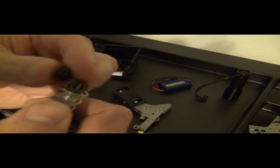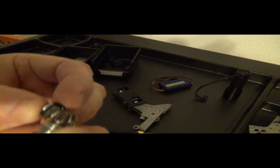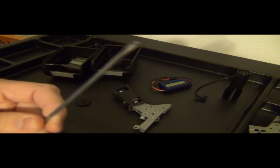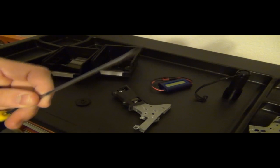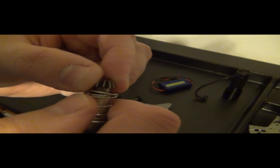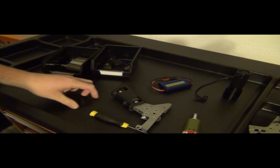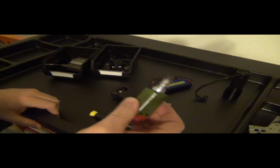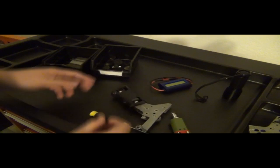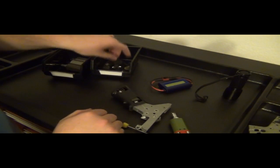Here's a Siege Tech pinion gear. And you can see it's a tiny bit smaller than the Ame Top. And it is actually more of a 45-degree angle of each tooth, like this. The Ame Top kind of shapes down like that, but then they cut it. You can see right here, there's little cuts in the teeth. They purposely do that. They purposely cut this last section off. I'm not sure why. But if I actually take out an Ame Top gear and show it to you, it does not even mesh very well to this pinion gear, which I'm not sure why. But if I take out a Siege Tech pinion and mesh it to the Siege Tech bevel, it meshes very well.